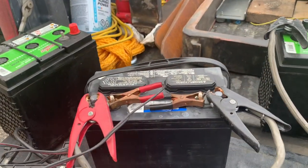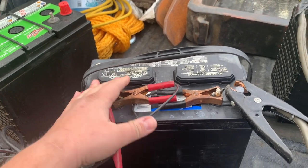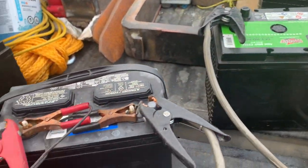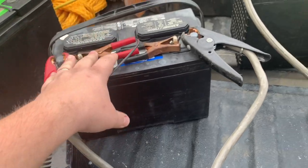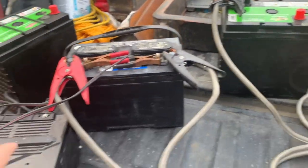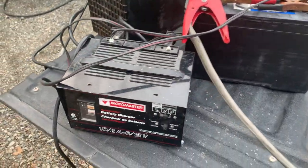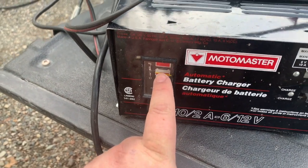The way I've done it in the past is you just get another 12-volt battery. I hooked this to booster cables to bring this up to start charging it. And then this morning I hooked the battery charger on it to this one so that it'll go through and trickle charge that one. Because if you put the charger on directly, it won't charge it — it won't even recognize it. When I put it on this morning, it was down low, but it's already charging.